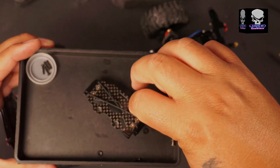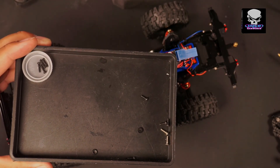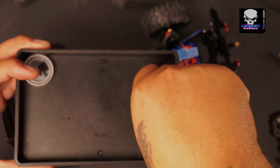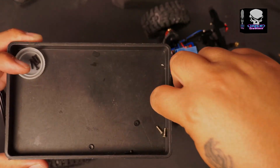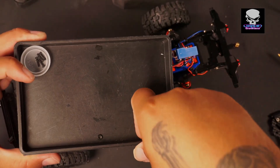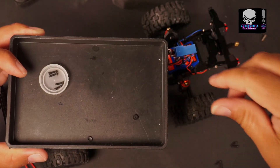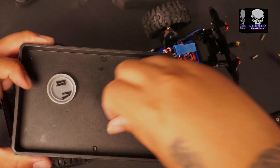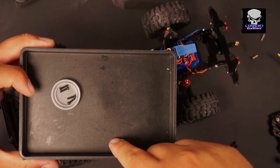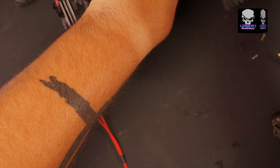The transmission mounts are with this battery cage, so we're going to take the battery cage and move it out of the way. I'm going to grab these four bolts — one, two, three, four — the black bolts that are in here, and then this one right here. These battery bolts I'm grabbing now but not putting in until last. And then the two spacers as well — there are the two spacers.